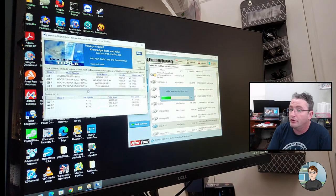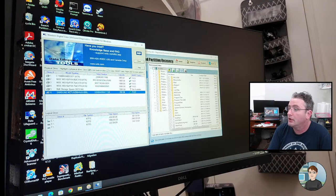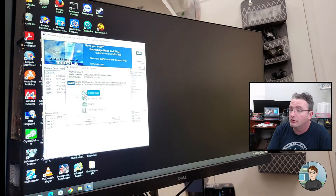Data Lifeguard. If you do a search for WDC Data Lifeguard on Google, you can find a link to it. It's a free program. It tests drives, hard drives and solid-state drives, and also allows you to erase them. All right, let's quit out of that. Didn't need that. So right-clicking on the drive. It's a Samsung. Run diagnostics, and we want to do an erase.